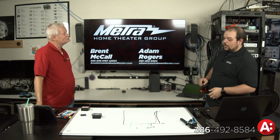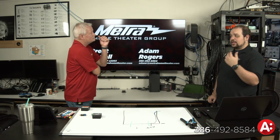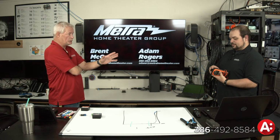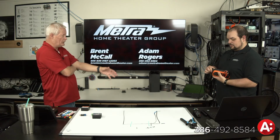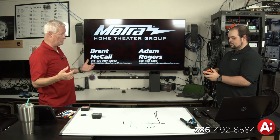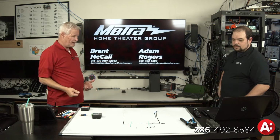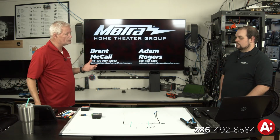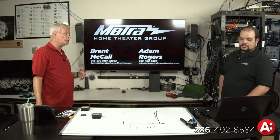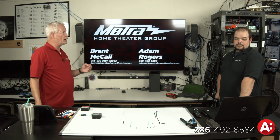So, we're at the TV. We've tested it with another source and another cable, and we're not getting anything. So now we know the TV inputs are good, and we actually tried the cable at the other end. So now we have to look at the cable, or the extender, or whatever the connectivity is. Particularly if it's an active cable, we have to look at that, because if there's a cable box in the system, which we've taken a lot of calls on, they tend to overvolt, so we have to look at that possibility.